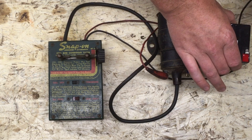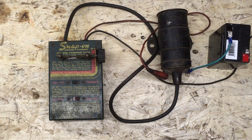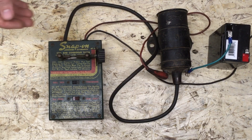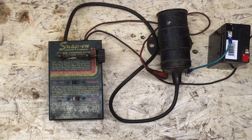So that's an example of how a coil that might test good when you're sitting in the garage — when you get out on the road and you've been out there for 10 or 15 minutes and things are starting to get hot in the engine compartment — you can start to experience misses, like the engine stops, just all kinds of weird performance. Because if this is not making spark regularly, you might be getting a spark on cylinders one and two but not three, or you might get it like 75% of the time on different cylinders. So that is a real concern.